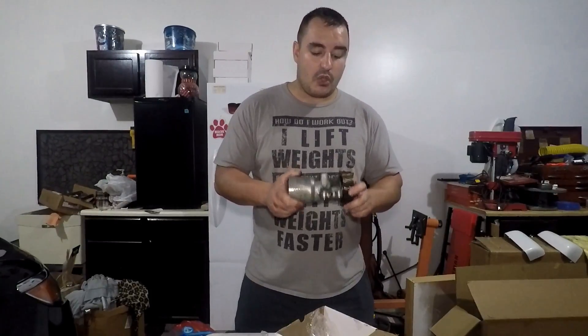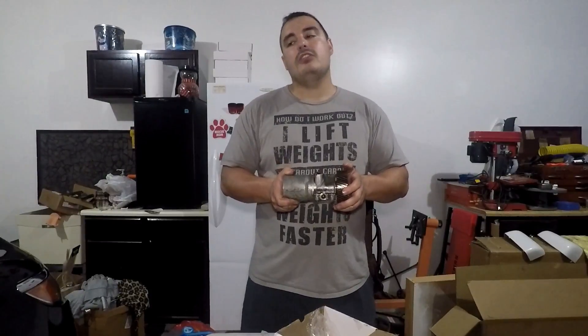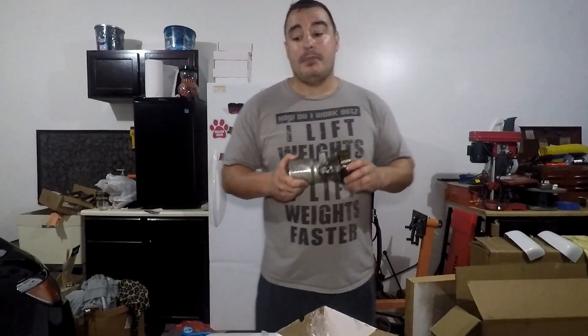The difference between their stage 1 and stage 2 pump is that the stage 2 can hold up to 275 CC injectors quite well — meaning maintain oil pressure. Those of you who know the six liter Power Strokes know the injectors function on a hydraulic oil system, and that's what this pump supplies. A stock six liter pump will typically hold up to a 190 CC injector, and you might start running into issues at dyno and drag strip events much beyond that.